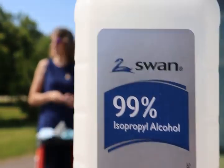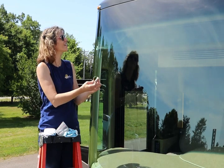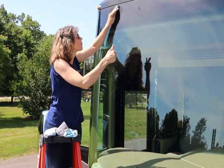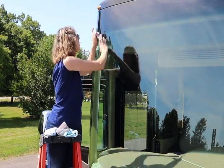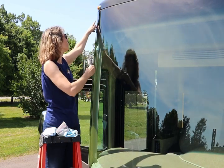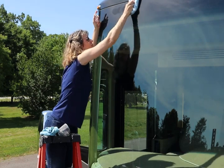Now preparing the outside of the windshield: the top section is where the exterior magnets are going to go. We're going to be using interior magnets in all locations of the windshield shade except for the top. Here again, use 4-0 steel wool, alcohol and water to make sure there's no wax. Go through this process on the whole top of the windshield to get it clean, then follow up with the silane — just like the side window shade installation — to create the water vapor barrier and really help the adhesive stick.